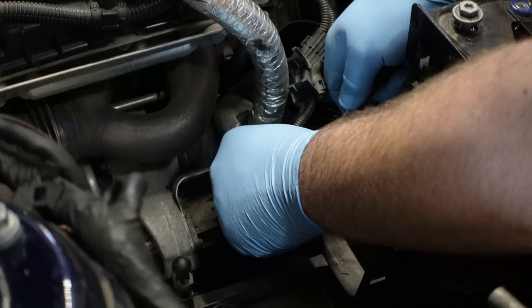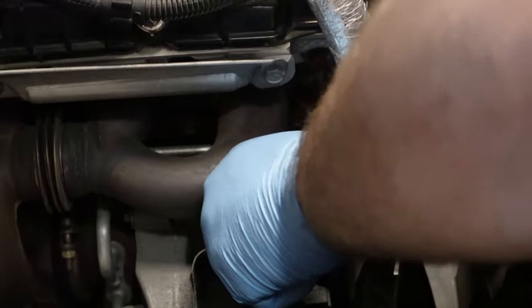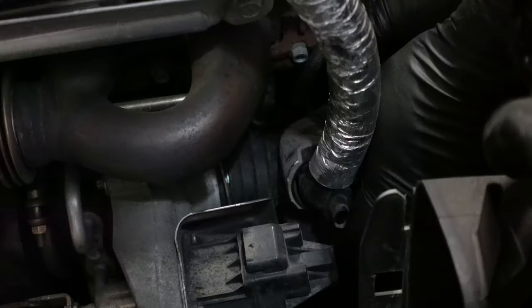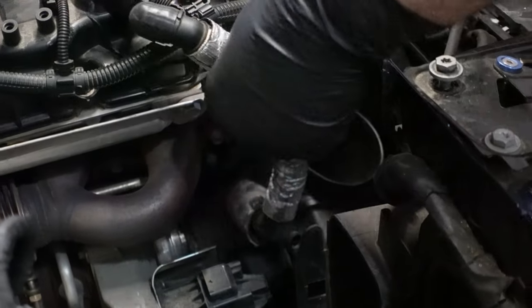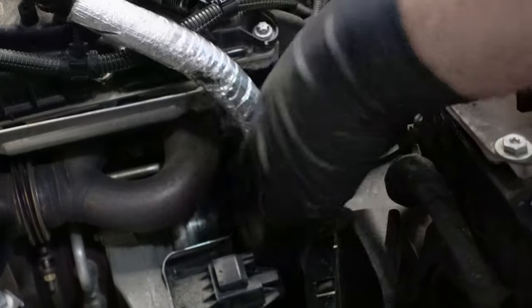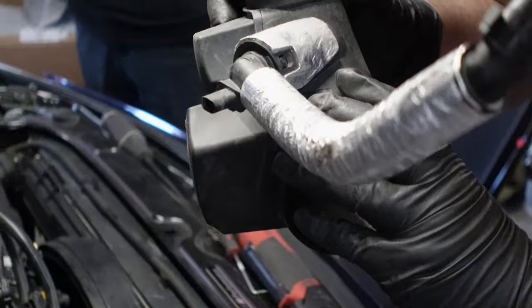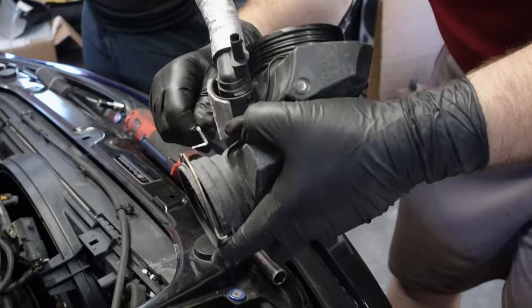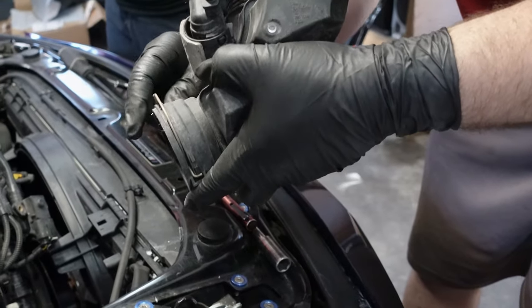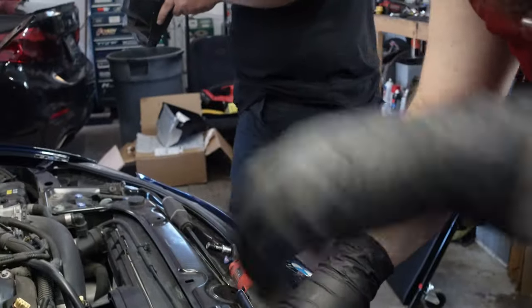When you go to remove the front inlet, a couple of things to make note of is that the clip ends up connecting on three different sides. So what you're gonna have to do is get your 90 degree pick tool, and of course if you don't have one, you're gonna be fighting way worse and way longer at this. You're gonna need to pick off both ends, the left side and the right side. Make sure they're up and over the plastic so they don't snap backwards and lock it back onto the front snout of the turbo. And after you have both released, the one right in the middle is going to be the one you need to pick up and out. Once that's done, you shouldn't have any issues after a little bit of wiggling, and then the front inlet should come out with no more fights.